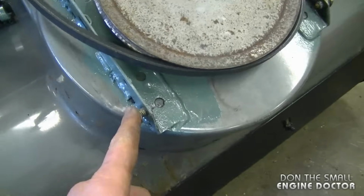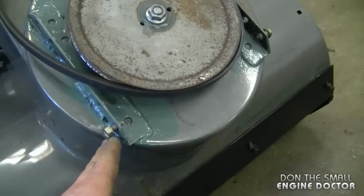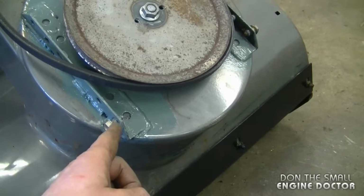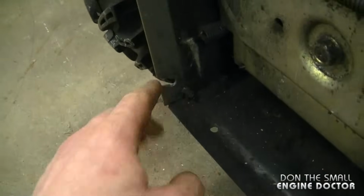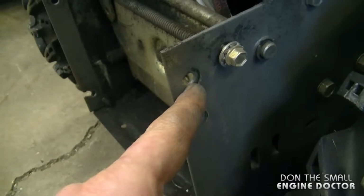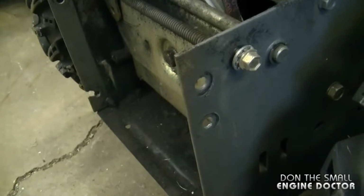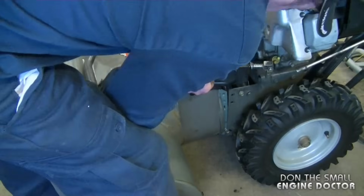And you'll notice I have a bolt on each side, but it's not fully screwed in. The reason for that is that it's going to catch in the grooves on the blower, right down here on each side. It's going to pivot in there, and then I'm going to put some of the top bolts on right away to keep it together. So make sure you keep the other bolts in your hand ready.